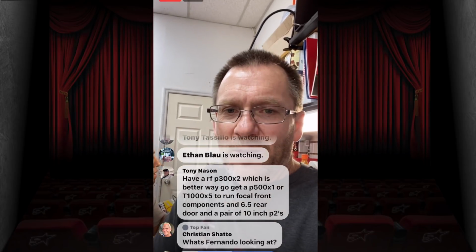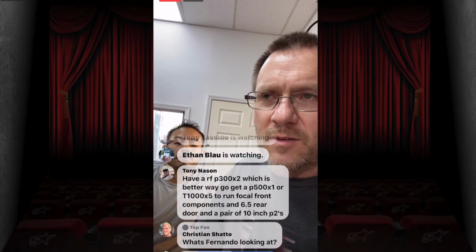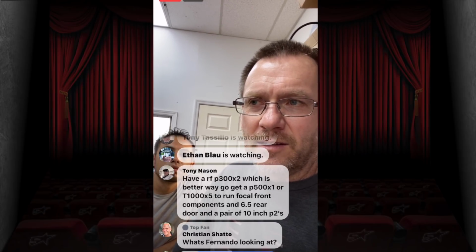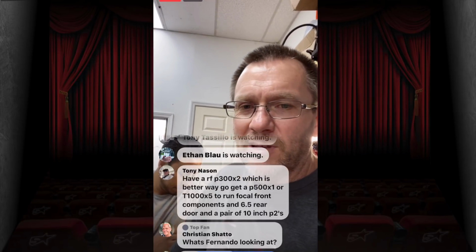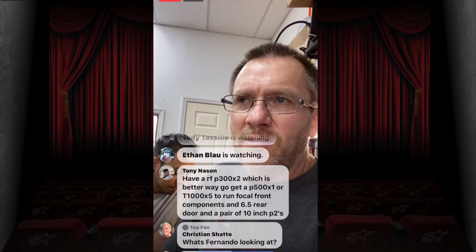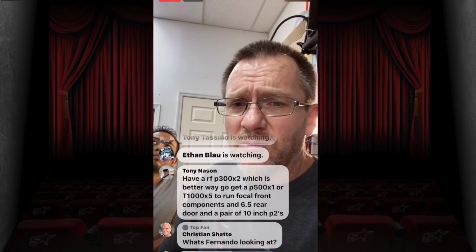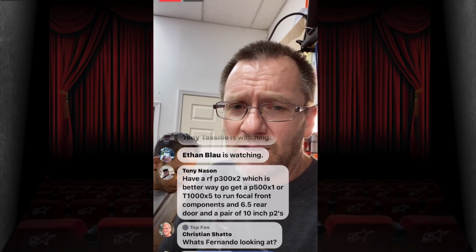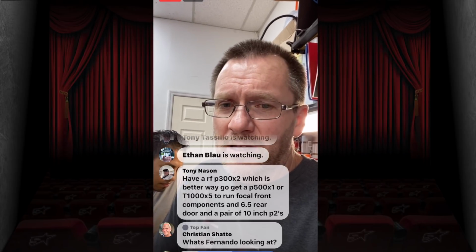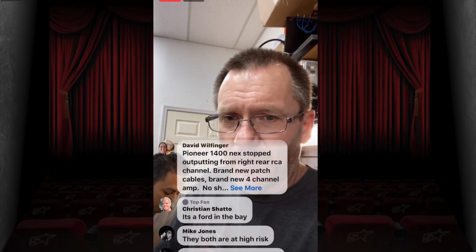I mean, okay, so the 501 is probably going to be a little bit more power than what comes out of that 1005. The advantage of the 1005 is that you're going to get a front and rear. They're, again, not totally necessary. I wouldn't run a Prime 2-channel on my highs. Well, that might be the AB class one. If that's the AB class one, which I think it is, then yeah, you're fine. You could do that. Just get the 501 and not do fader. I mean, if you're just going straight power, not worrying about EQ, DSP, and all that fun stuff, yeah, that'll work.